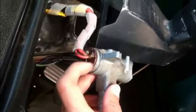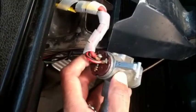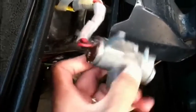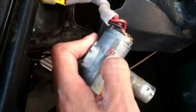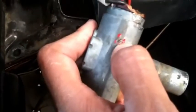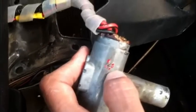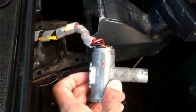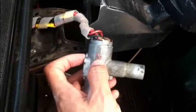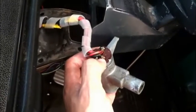I'm going to take this out because I think it's causing problems — it's not letting my car start. To take this out, there's a little tiny screw, super tiny, and you need a really sharp flat screwdriver. A small screwdriver — like the kind used for sunglasses — would work. Loosen that, don't lose it, be careful when taking it out, and that'll allow this to come out.